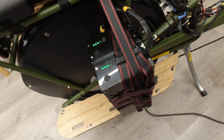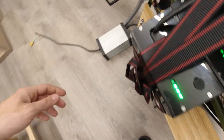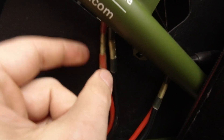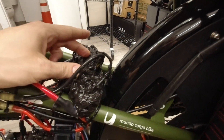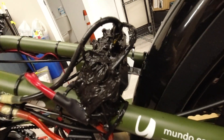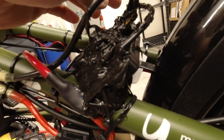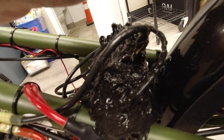To make up for the fact that they're smaller, there are two on each side instead of one. Each one of these batteries has a nicely sleeved XT90, nicely crimped with those waterproof crimps that have the three-to-one heat shrink on them that oozes out that adhesive glue-ish material to keep liquid from getting in. All the grounds are going to a bus bar up here. This bus bar has a nice cushiony purple piece below it so it's not lying straight on the metal of the bike, and it's tied down. It also has silicone to keep any liquid from getting on it.